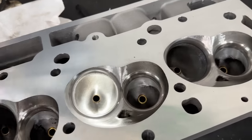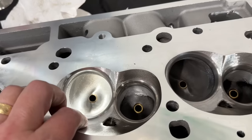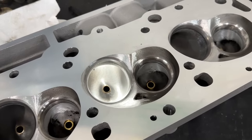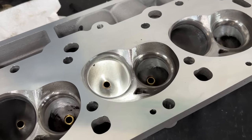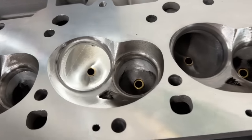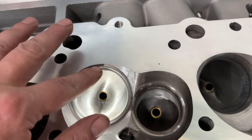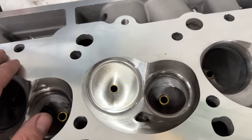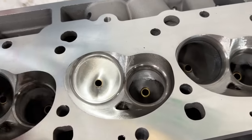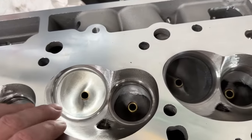Since I had to redo the valve job anyway, I put on a good one — a 50-degree valve job. Standard is 45 degrees. A 50-degree valve job typically flows better at higher lifts but not as well at lower lifts; it actually hurts compared to a 45 down low. On the exhaust I kept it exactly 45, just re-cut it. The only blending done was because I had to drop the seat quite a bit to get the angles to come back in after the milling.